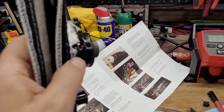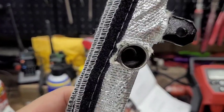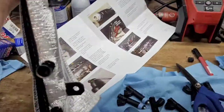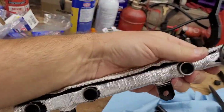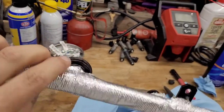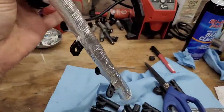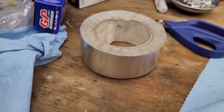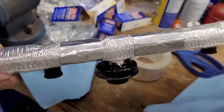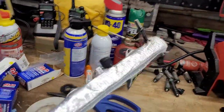After I got the fuel injectors back off, I aligned all the holes - remember you've got to cut a hole if you have this fuel damper. It comes with holes for the fuel injector inlets, holes for the Schrader valve pressure release, and all your mounting brackets. Velcro it up - this is what it looks like all velcroed up. I'm going to put reflective aluminum tape where I cut to keep it from splitting further. It looks a lot more insulated than what came from the factory, and I used the aluminum reflective HVAC tape around the cut area to prevent any more tearing.